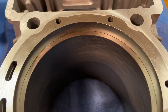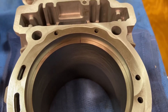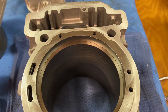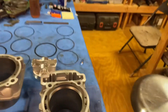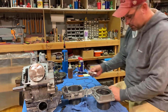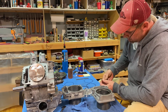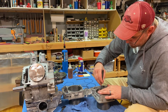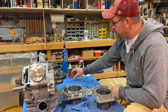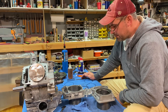As you can see there's your piston ring gap. I'm going to get my feeler gauge. The top rings on these pistons need to have a minimum of 20 thousandths clearance, the second ring is 24 thousandths, and the oil rings are 15 thousandths. You take your feeler gauge to 20 thousandths and slide it in that gap. I already know this has got proper clearance — I did have to file these top ones, but not very much. The other rings were already fine; sometimes they'll be fine brand new.